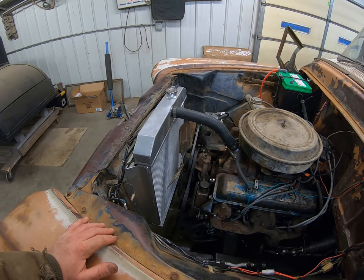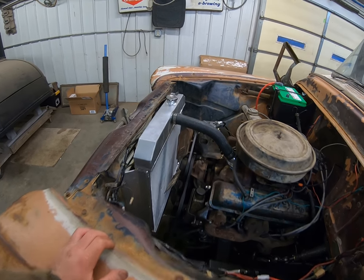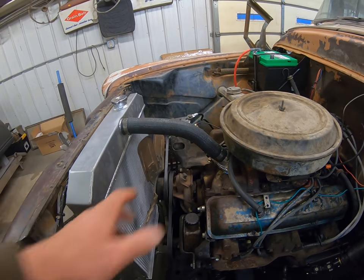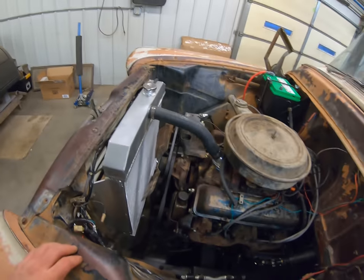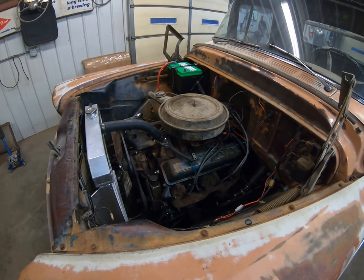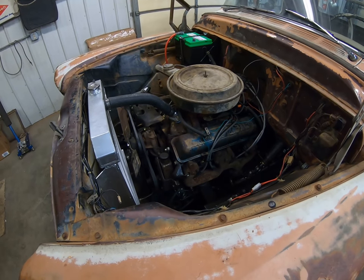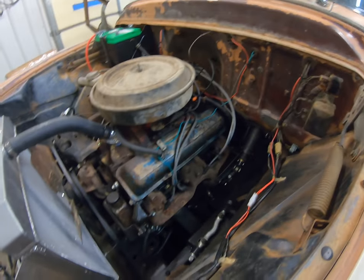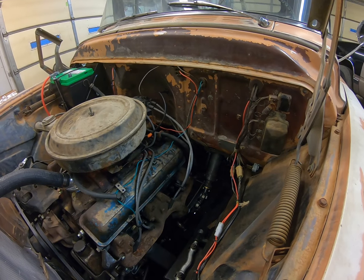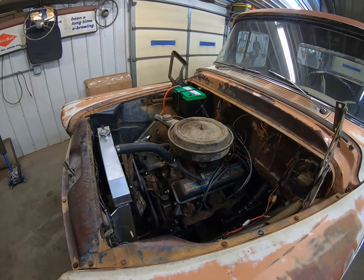It's about 30 degrees out here right now so I haven't had a ton of time to run it and see how warm it gets — might have to add a fan shroud. Right now it's just a direct fan on the long water pump. Plenty of room in there with stock radiator hoses for a V8 application pickup, so that panned out pretty well. That V8 is out of like a '77 Chevy two-wheel drive pickup — literally know nothing about it, but it was supposed to run so we threw it in there. Seems like it runs all right. It's got a few oil leaks; I just put valve cover gaskets in it so there's a little residual oil on there. The transmission was super greasy — Turbo 350, nothing special. HEI, Quadrajet — I just kind of tried to leave it all stock stuff so you can buy parts on a Saturday at your regular parts store.